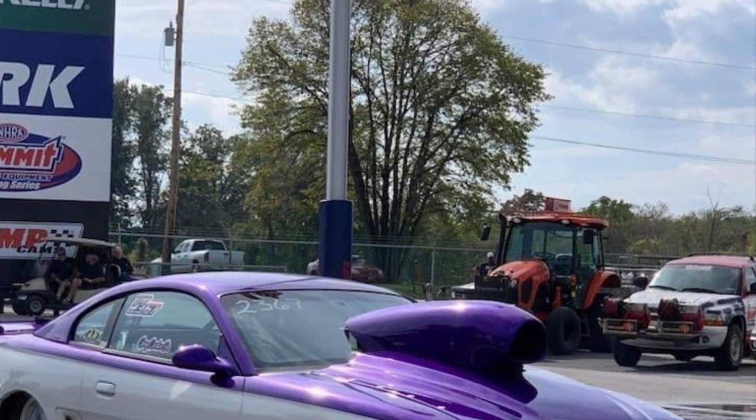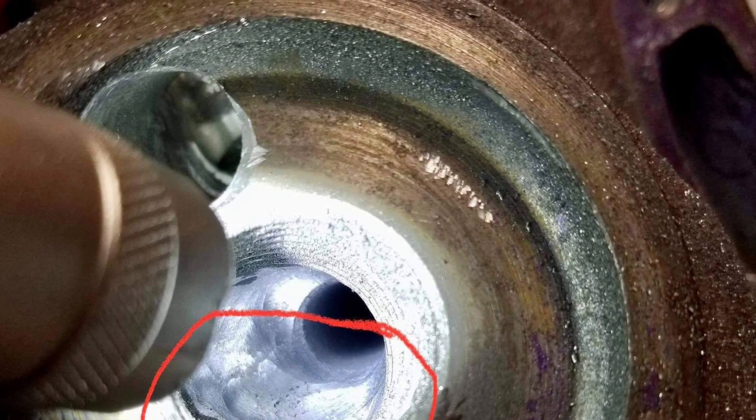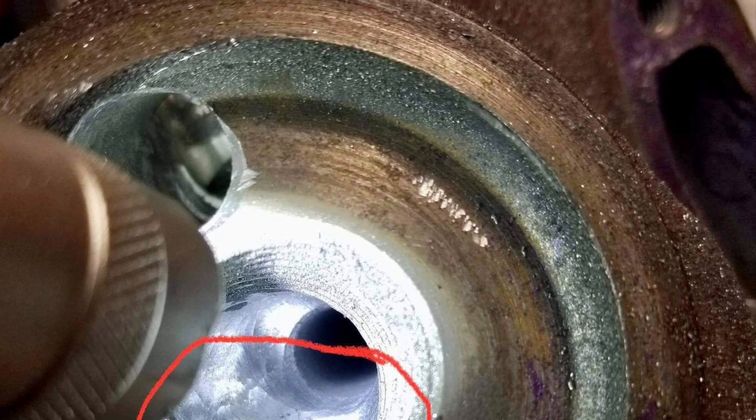So we started building this motor. He asked me about some of the oil mods — he watched some of my videos and I helped him through a few things and it really turned out well. This is where the oil pump mounts — there's a torture area there. He also did the oil filter pump boss, smoothed that all out. He runs a Tim Myers oil filter adapter so you can run the 2868 Wix filter. He also has the front-to-rear line.